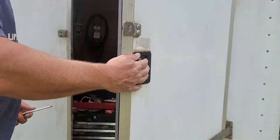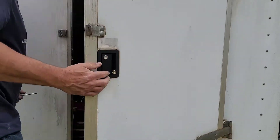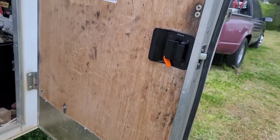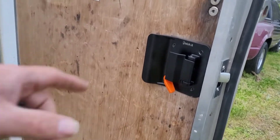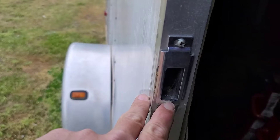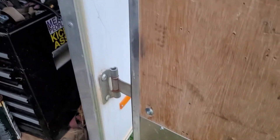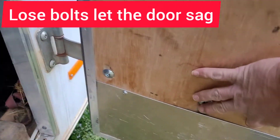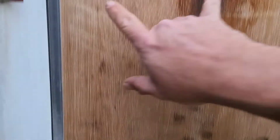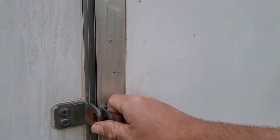Let's check it out and see how it closes. Whenever I got the latch installed, it wasn't that big of a deal — just the four screws and putting it in. But it kept hitting whenever the latch would close; the deadbolt wouldn't work. It was coming in just short of the hole. I was sitting here thinking, well, that doesn't even seem right. So I got to looking, and I grabbed a hold of my door and lifted up on it. These two bolts were loose on the hinge. This is an old trailer and it's been dragged around a lot.